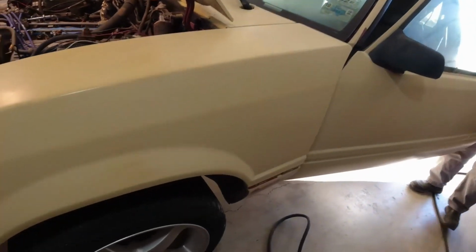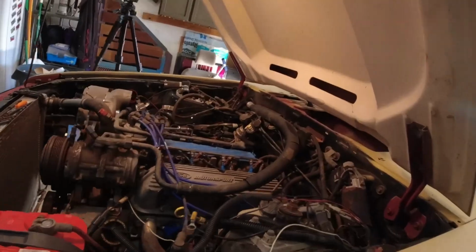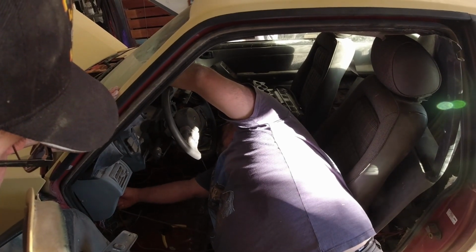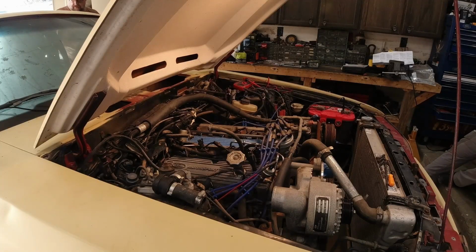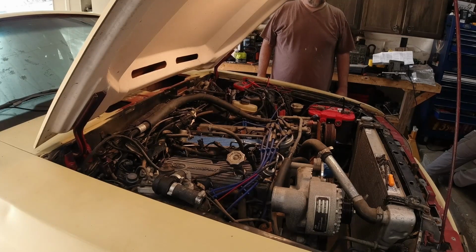The car alarm's definitely going off. Is that just the door ajar button? No, I can hear the hazards going dook, dook, dook. I'm not sure why the key's out, but it's doing it. Why it's doing what? The door chime. Well, when you close the door the chime stops. I know, but the door chime shouldn't go off when the key's out. Oh, it's probably just worn the f*** out. Like the ignition switch. I wonder if it's just in the switch. The problem's in the switch. I think the alarm is going off, and it is disabling the fuel pump.